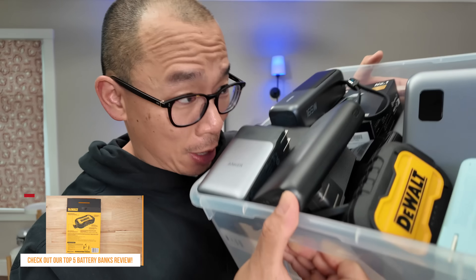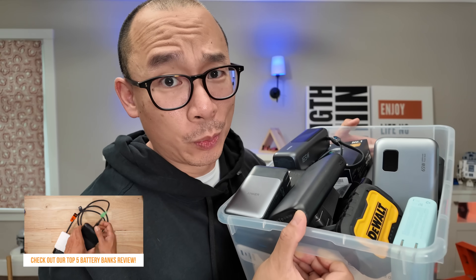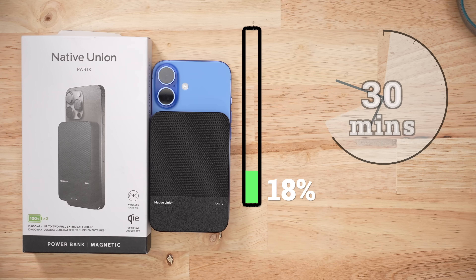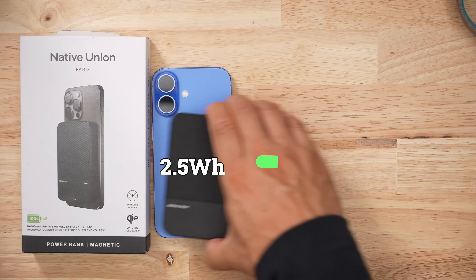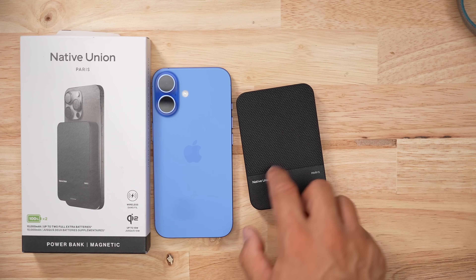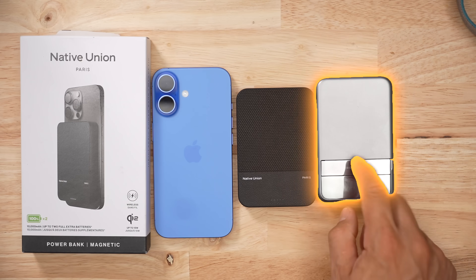I'm still in the process of testing a bunch of wireless battery packs, so I don't yet know if 61% is a good or bad value. I do know that when I compare it against a normal battery pack, that is a very low value. When it came to wireless charging, I gave my iPhone a charge of 18% in 30 minutes, or 2.5 watt hours, but it took the bank 3.2 watt hours to do so — that's actually a pretty good efficiency rate of 78%. The last battery pack I tested, this Ugreen thing, was only at 70%, and I thought that was pretty good. 78% is spectacular. In fact, the wireless charging efficiency for this product is almost double the next product I'm going to be testing, which is from EcoFlow.